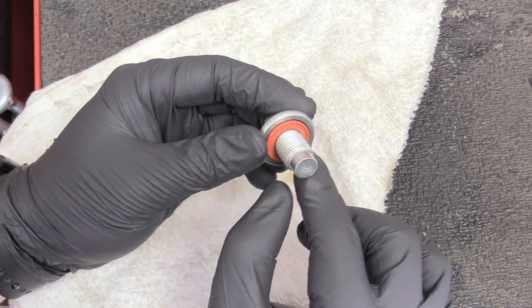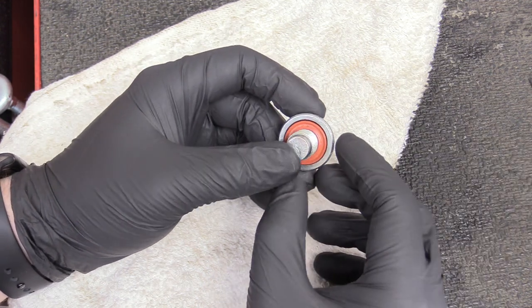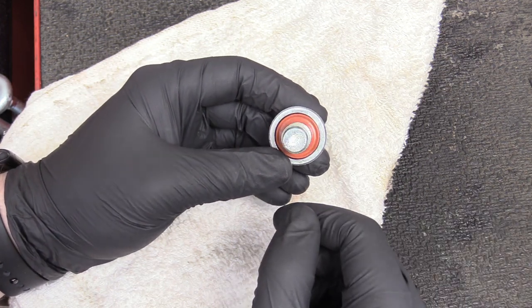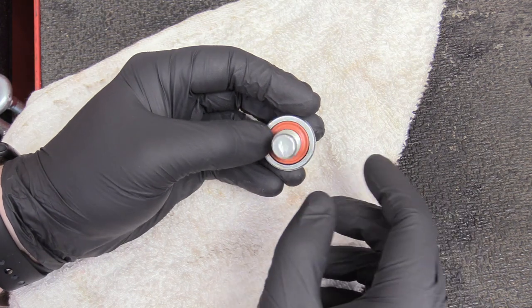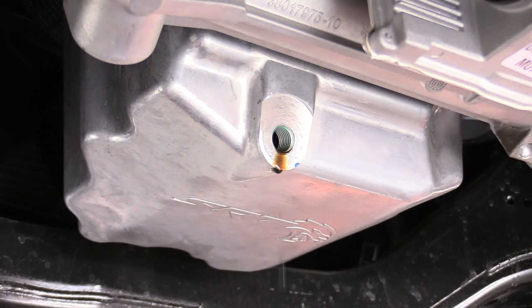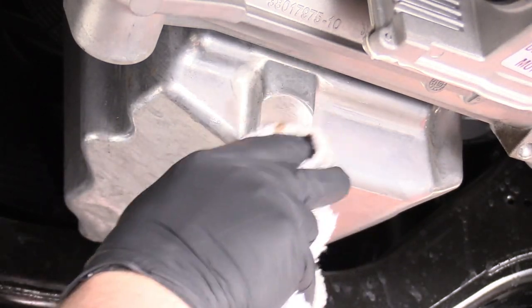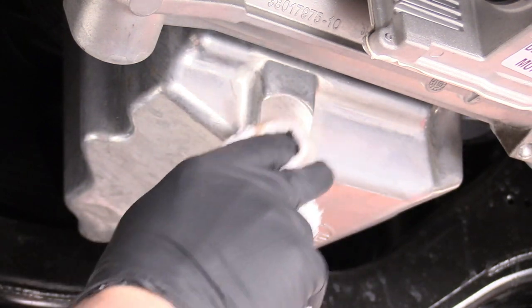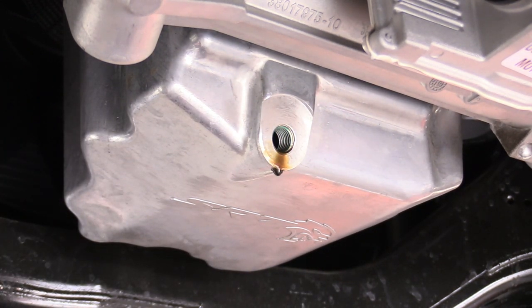Look at the o-ring and make sure it's in good shape. Ours is in perfect shape — this is the Hellcat's first oil change so the seal is basically brand new from the factory. But if you're watching this in the future and the seal has decayed, go ahead and replace it. You can get this seal at AutoZone or online — I'll leave a link in the description. Clean the mating surface and use some carburetor spray on a terry towel to wipe it down, making sure there's no foreign material between the seal and the oil pan.